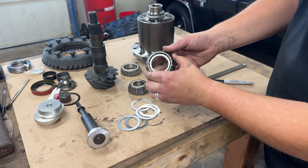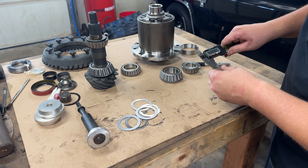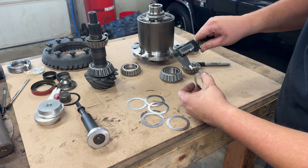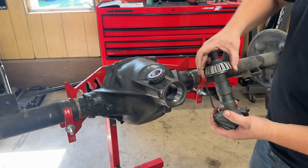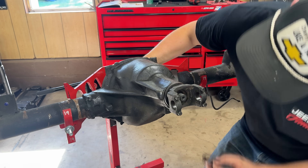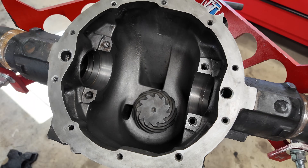We're ready for pinion assembly. I made the inner setup bearing with my die grinder and it slips right on, plus our outer setup bearing. I measured the shim from the stock setup and got around 36 thousandths. Looking at the shims that came with the gear set, we got two stacked together that's pretty much exactly 36 thousandths — so that's the one we're going to run. We'll send our 36-thousandths shim pack with the inner setup bearing through the housing, then the outer setup bearing, and go straight to the yoke — no crush sleeve or outer seal for setup — and torque it down until there's just a little bit of drag.